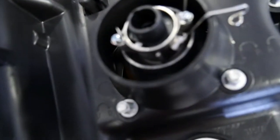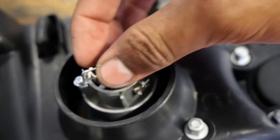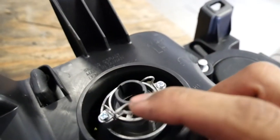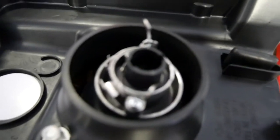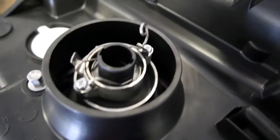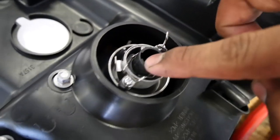You can see I turned it and then it'll come out. So we took the headlight out, the bulb, but the housing for the bulb is still in there. Now when you want to close this it won't close properly because it's an aftermarket bulb, so you have to modify it a little bit. I went ahead and bent it - you just kind of have to maneuver it with some pliers. Don't bend it enough to where you break it.